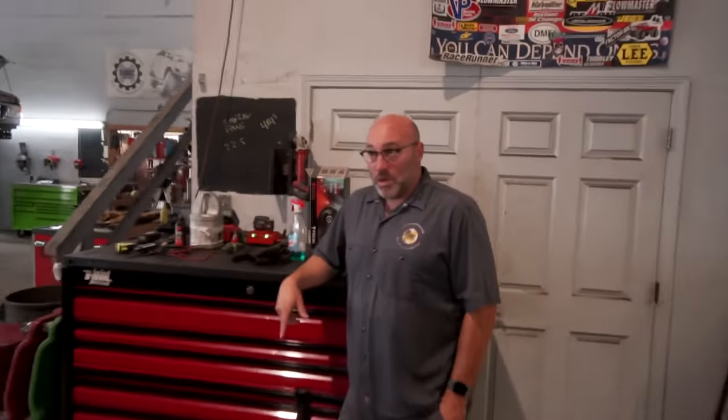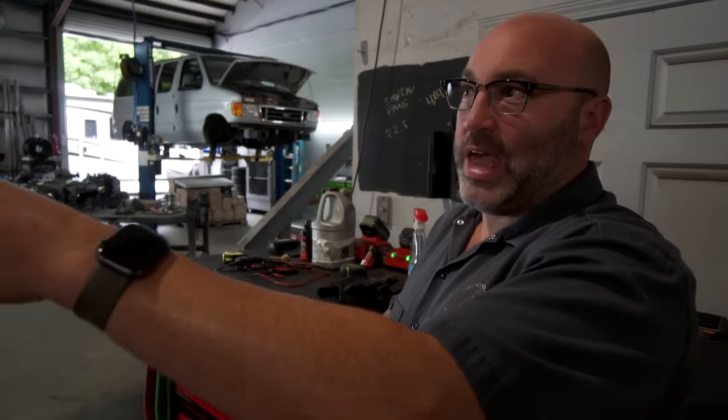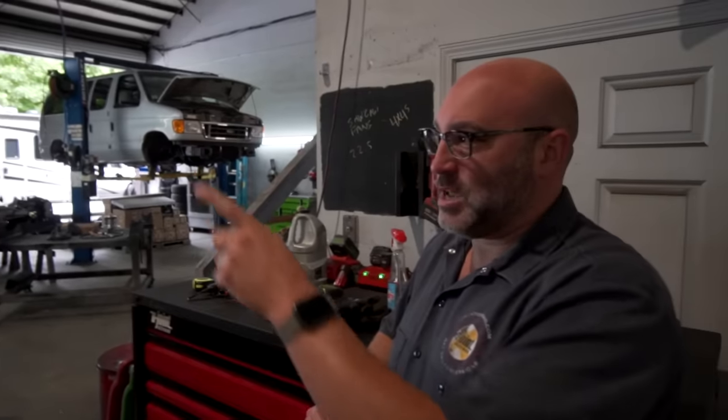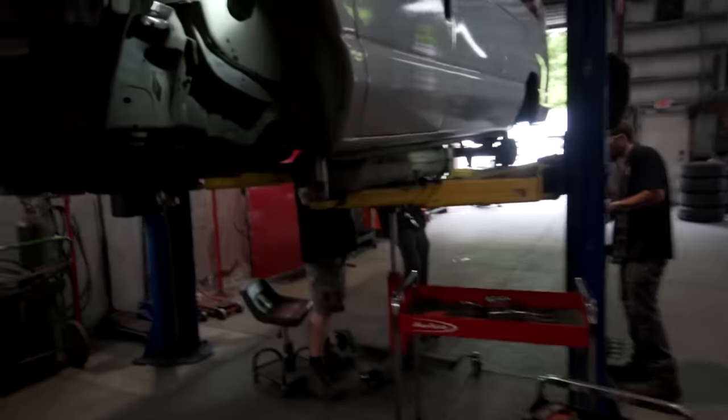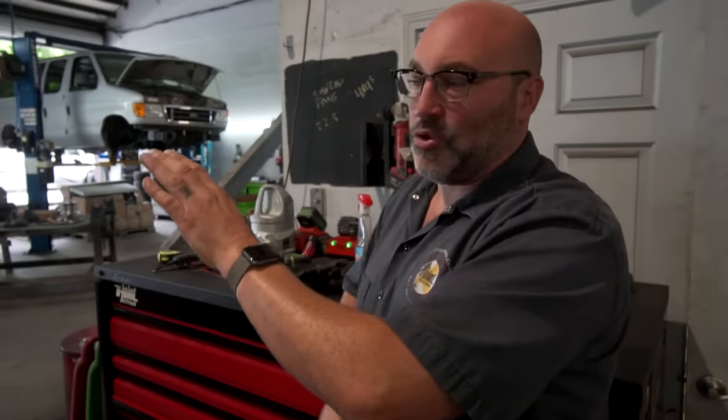What phase are we at right now? Because they've already dropped the whole front end. Front end's out. They're prepping to install the spring hangers that we've already pre-drilled, and then we're going to get the plasma out and cut the shackle sleeve holes, cut the engine cross member, then weld the shackle sleeves in and weld the upper shock mounts in. And then all the cutting and welding is done - then hang springs. Also the fuel tank's coming out right now - we're going to chop the cap of the fuel tank off. We're going to lose three gallons of capacity to make room for the T-case.